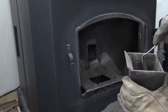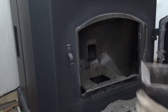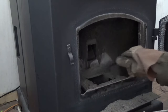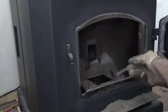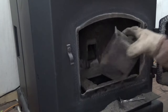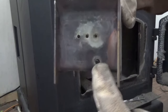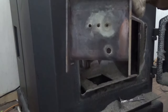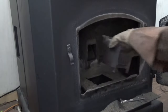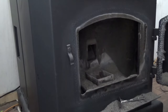Give it a good scrape so all those vent holes are free. I'm going to scoop the ashes away from the hole where it turns back in. Make sure it locks back down. The big thing to keep open is right here — that's where the igniter comes through. It just glows really hot when the pellets drop down into it, so you've got to make sure that it's clear.